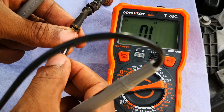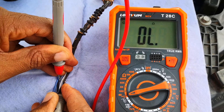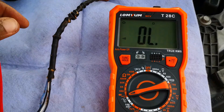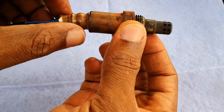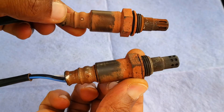Just to double check, I'm going to pierce these wires directly above the fraying to see if we have any reading — and there you have it, still no continuity. If you have a result where the wire is the problem, you can clean up the wires, tape them up, attempt a repair, and if the code goes away then you're good. However, inspecting this oxygen sensor more closely, there's a kink at this junction right here, and that's probably what snapped the wire within.